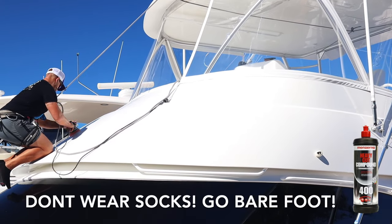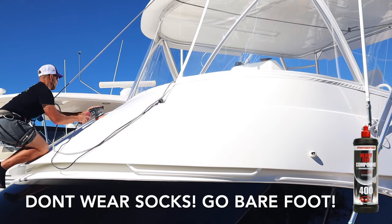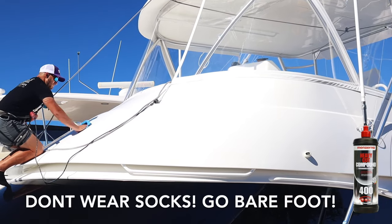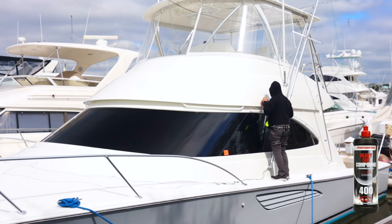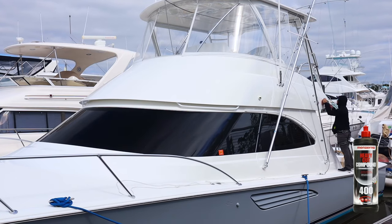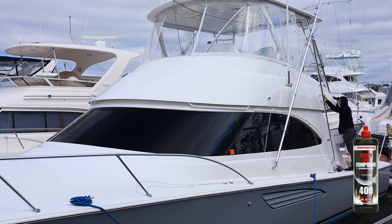When it comes to the polishing, we're using the Flex 3401 VRG with Menzerna 400 compound and the Lake Country Orange Force pad. We're going to do a side-to-side, up-down, side-to-side pattern for all of the polishing. I'll link a video on how to properly use the Flex 3401 VRG in the description below. We're doing all of the exterior of the superstructure with the polish. Always do the side-to-side, up-down, side-to-side motion and then wipe off your polish. Put four more dots on your pad, move down about two more feet, repeat the motion, wipe it off, and move on. Every single section: polish it and then wipe it off.